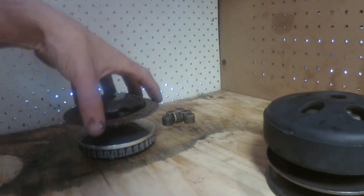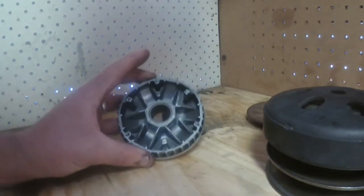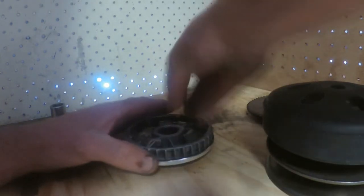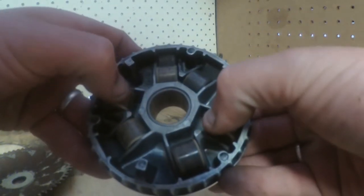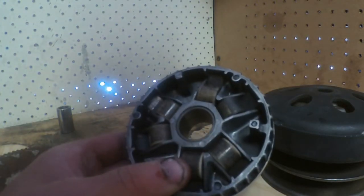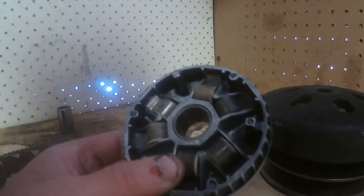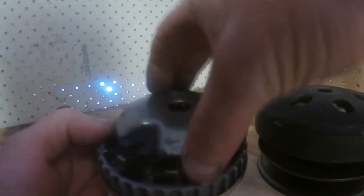It works off centrifugal force. So what we're observing is that on the drive pulley at the back, a series of rollers sit in here. The rollers sit in like this. As it's spinning — it's spinning at crankshaft speed, so controlled by your accelerator — these rollers are going to throw out as the acceleration picks up. The way I like to explain this: you would have seen the ride at the fair where it's like a UFO, you stand up against the wall, and then all of a sudden you get sucked up against the wall and start to lift as it spins around really fast. It's the same principle — it's centrifugal force, these rollers roll out, and what it's doing is putting pressure on this back plate.